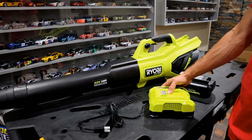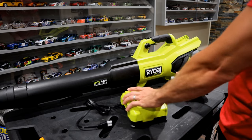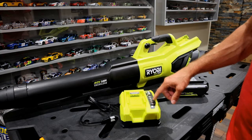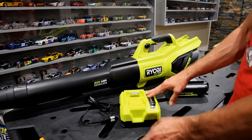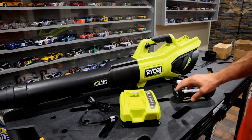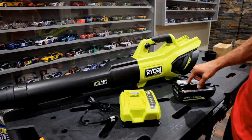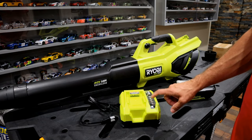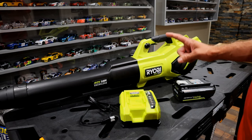One thing I did notice: after using the first battery and it got down to one bar, I put it on the charger. When the battery was hot, it showed solid orange, meaning it was testing the battery. I figured it would switch over to charging within a few minutes, but thirty minutes later it was still in testing mode. I pulled the battery off the charger, put it back on, and then it immediately started charging. I tried that again on the other battery just to see if it was a fluke, and it did the exact same thing. I'm assuming it's waiting for the battery to cool. If you need to keep charging and moving along quickly after the first battery dies, there might be a delay to account for. But other than that, I really have no complaints — my initial impressions are that I was very impressed with how this thing operates.